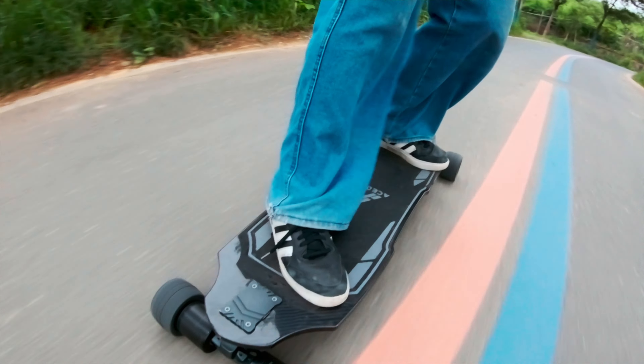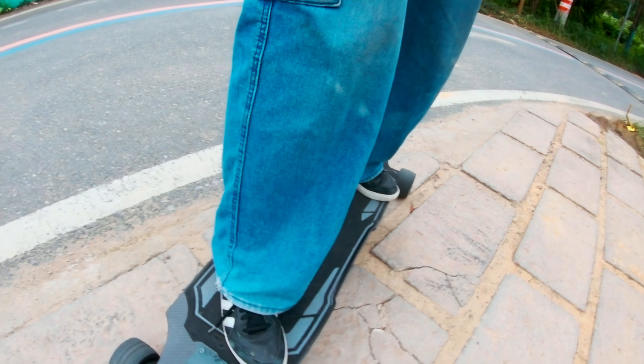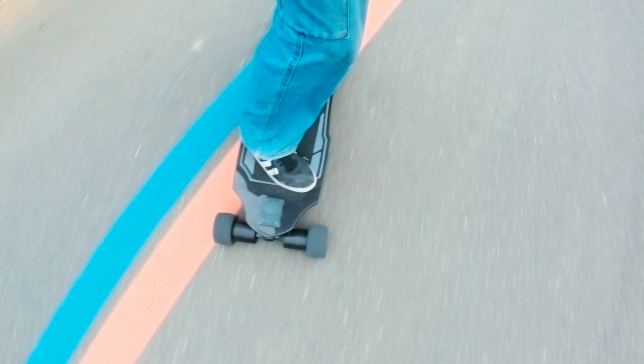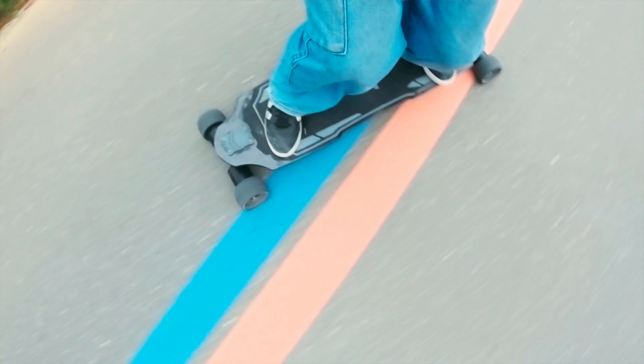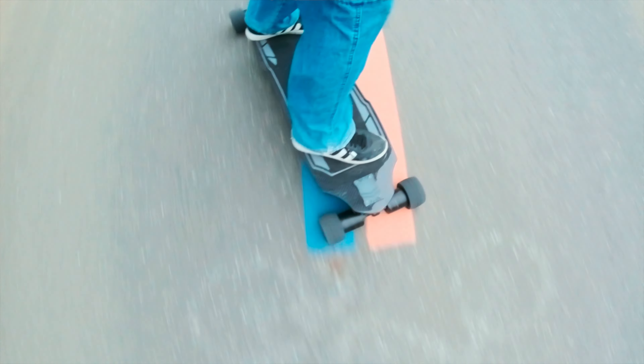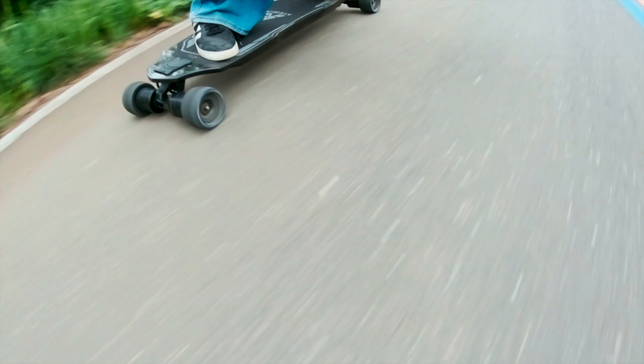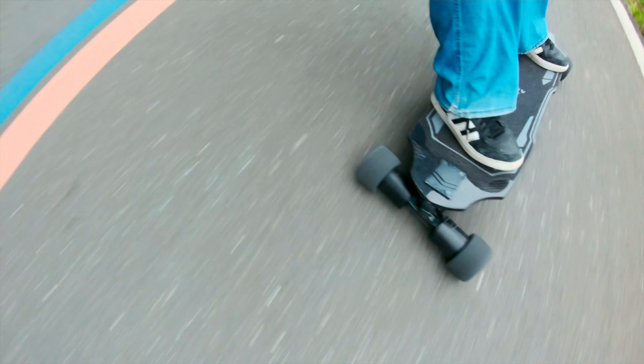At that speed, I would suggest wearing protective gear — at least a helmet and guards everywhere — because if anything happens, you're not in for a fun ride. Riding on this board, like I said, the feeling is very peculiar. It feels like you're riding a belt drive or gear drive board that has no sound, which terrified me a little bit at first because with more powerful boards I'm used to having at least some sound. In terms of comfort, the original wheels are not extremely comfortable on crappy roads, so putting on rubber wheels is going to feel a lot better. Polyurethane wheels usually don't do well in wet conditions, so rubber wheels are going to help with that too.